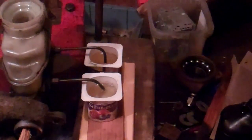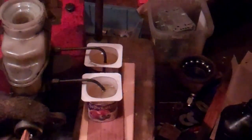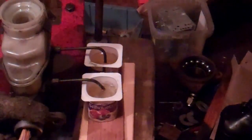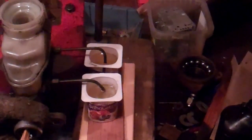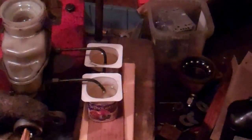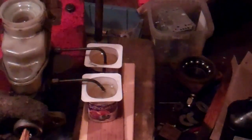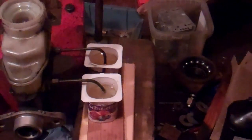And as I pump that piston in, and then I release it, what we're going to start to see is that the level in that jar is increasing with the brake fluid, but there won't be any more air bubbles. I'll top that up again. You see lots of fluid coming out in the jar. We're almost there now, so we basically just keep pumping that piston, adding the brake fluid until there's no more air bubbles there.